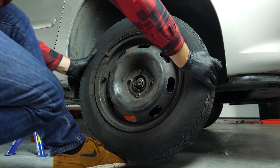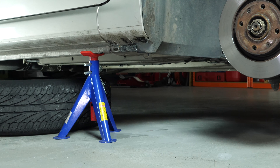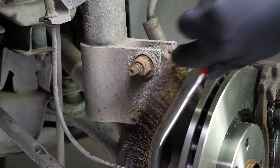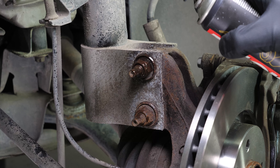You will then be able to take off the wheels. Don't forget to slide them under the vehicle. During this operation, you will work on the steering system of your vehicle. When you change the front shock absorbers, it is advised to check the wheel alignment. These elements can often get jammed, so use a penetrating oil to facilitate the operation.